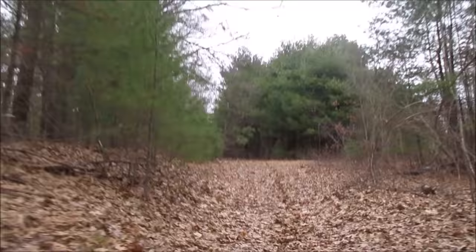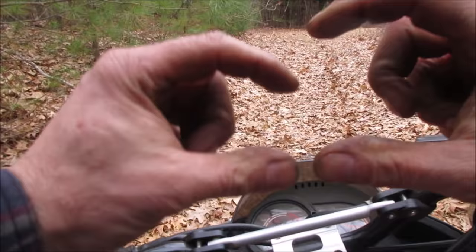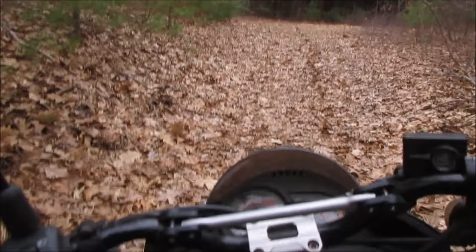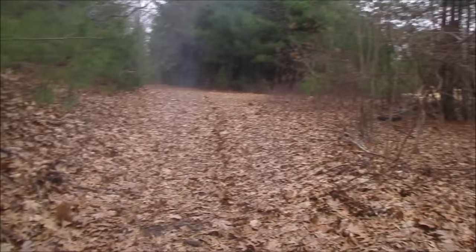I wonder if somebody tried adjusting the carb. The pin on the carburetor usually has adjustments for how far it comes out. They may have lifted that up to try to get it to run better. So I think one last ditch effort, we're gonna take that and change that pin up a little bit. That may just have so much oil in the bottom of the crankcase that's trying to burn, because it does still smoke pretty good. And that's just gonna be two-stroke oil, lots of it.